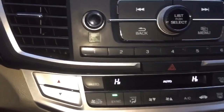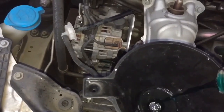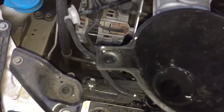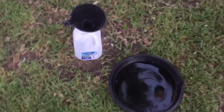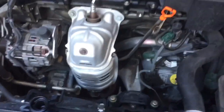All right, high heat — let the fan kick in. While the engine is warming up, I'm going to dispose of the old coolant. I have an empty gallon milk jug to put it in for recycling. I've capped off the coolant and now I want to get the air out of the system. There are a couple of ways to do it. Number one: run the engine until the radiator fan comes on at least twice.